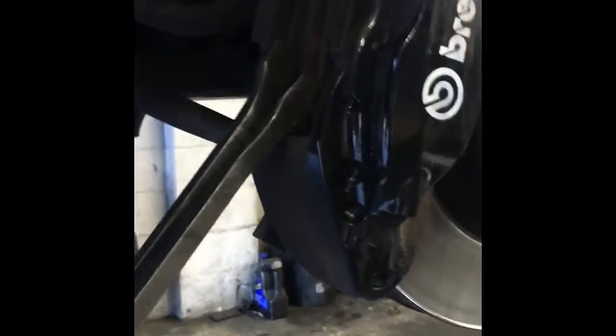So now we need to compress the brake pads back in. What I do is I get two pry bars like so and hook them in the pads and squeeze them until I get a gap between the brake pads. Then I got my pry bars in between the brake pads like so and pried the pads back into the calipers. And if you notice, I left the top pin in — that helps keep everything aligned while you're doing this. You'll pry it until both the inner and outer brake pads are fully seated.